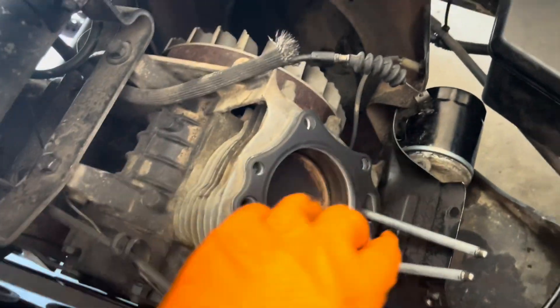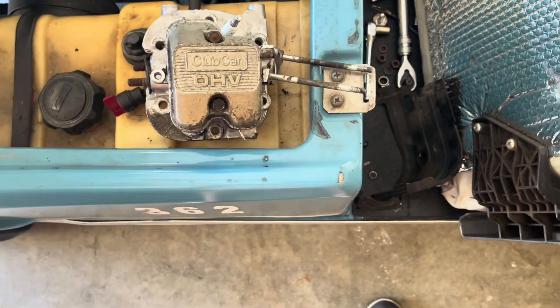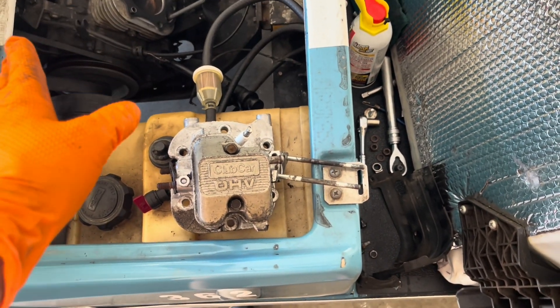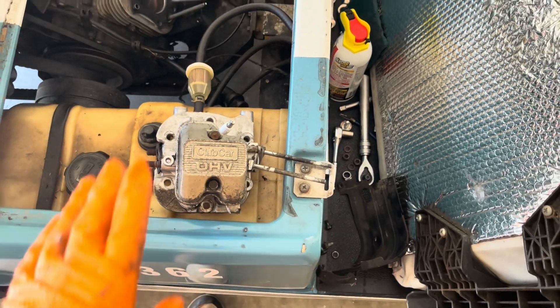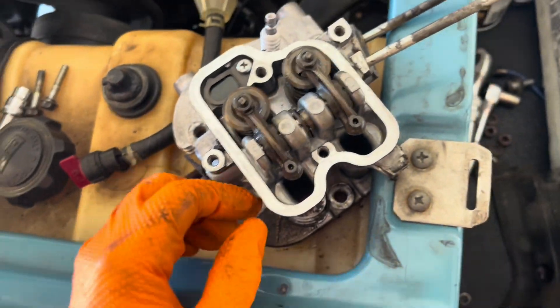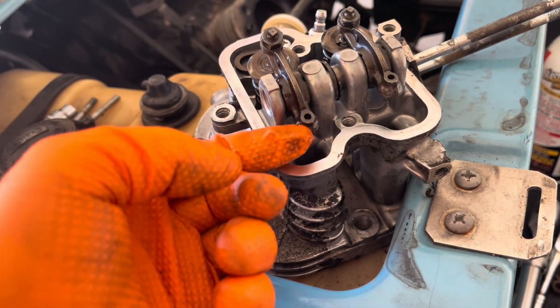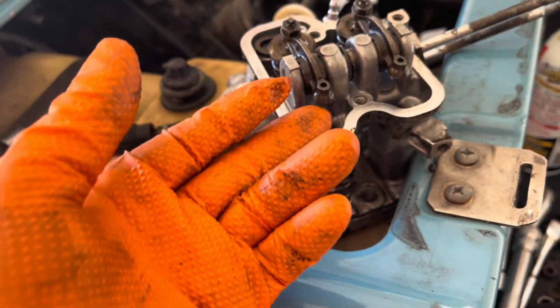The valves are going to be a bit of an issue. I think what I might have to do is take this part of the head off where the valves sit and align it back up. We're going to put the head back on but take this cover off so we can get the lifters lined up with the valves. Here's the gasket — the lifters are going to go underneath these rockers and we want to make sure they get seated in there properly. The only way to verify when you put the head back down is to take the cover off so you can see that the lifters are in the right space.